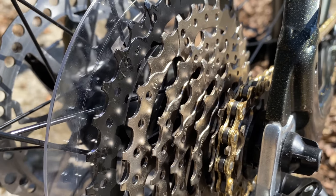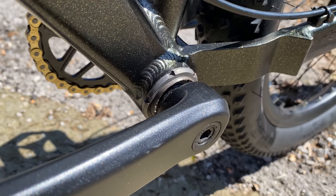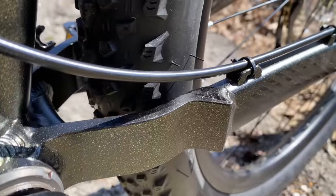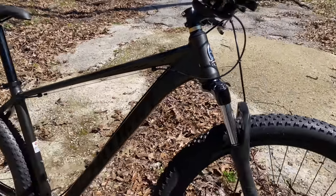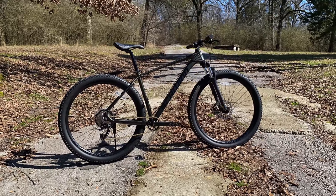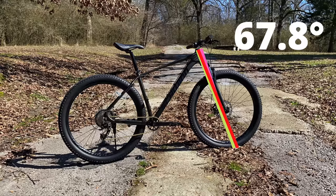At $399, I actually expect a cassette. There's a square tapered bottom bracket, and look at the frame at the bottom bracket — this is how a fat tire bike is set up. This is an alloy frame with modern and less big-box geometry, and we've already been seeing improvements in geometry, and on this frame it's stepped up even more. Old big box geometry had steep 70 to 71 degree head tube angles, and the new Aluminum Comp, the new Boundary, and the new TAF went with a 69 degree angle. The Axel slacks it up a bit more — 67.8 degrees.